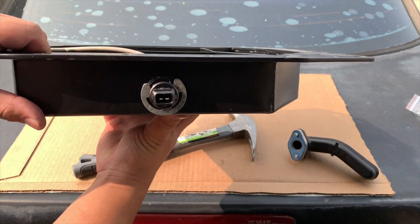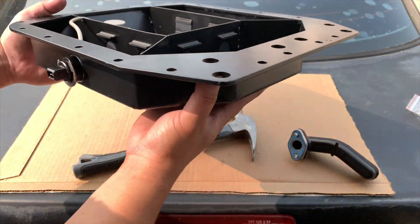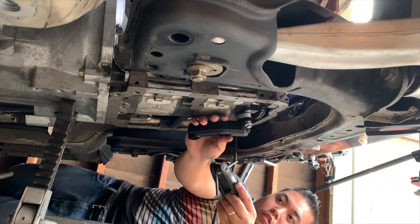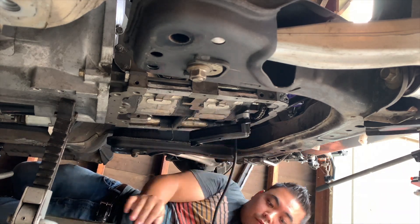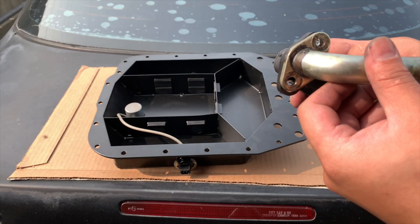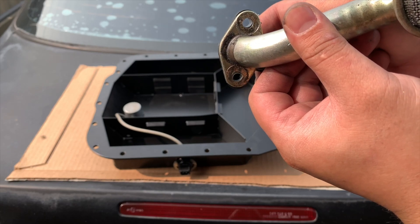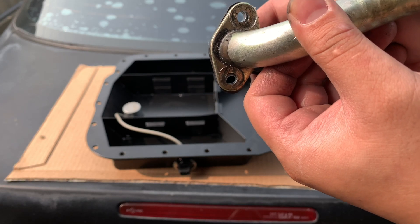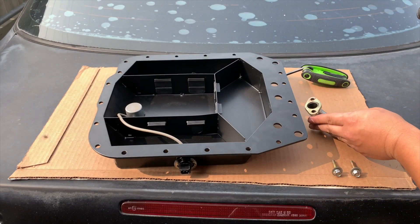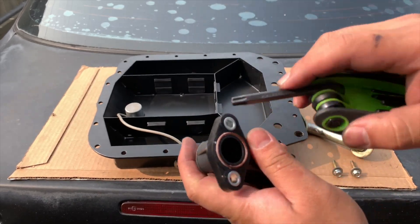Here's the oil level sensor fully installed. The pickup tube was not bolting in, but eventually I figured it out. Comparing the holes and lining up the REW pickup tube with the RX-8 one, the inner spacers make the holes not line up properly. My solution was removing the spacers — if you're watching this Nikon Rotary, confirm this is the right way to do it. It's pretty easy popping the spacers out; just give it a little force and they should come out easy.